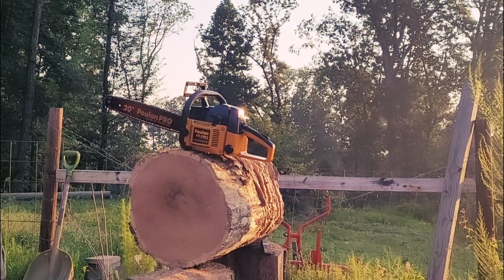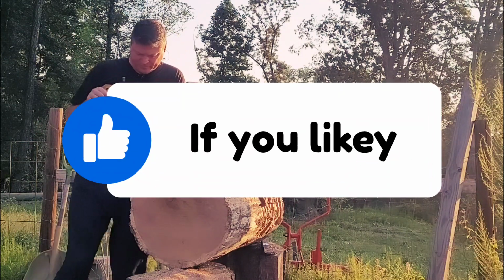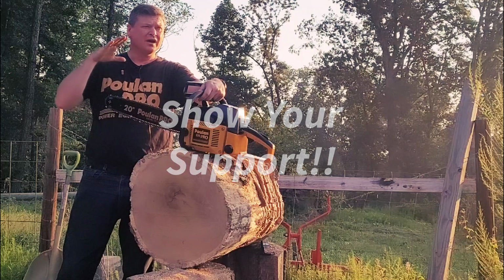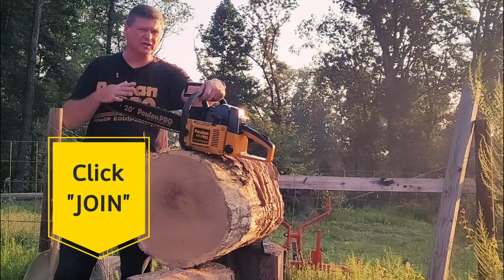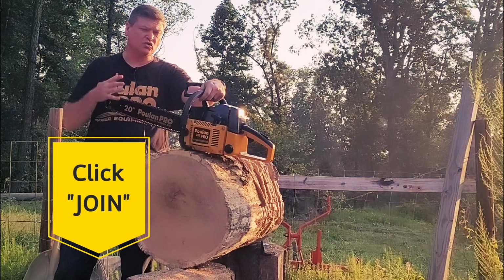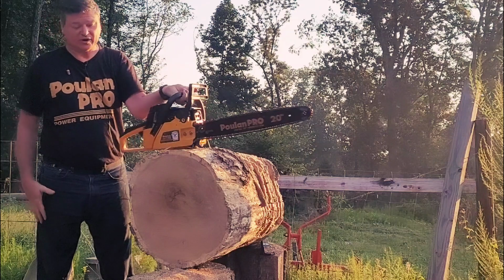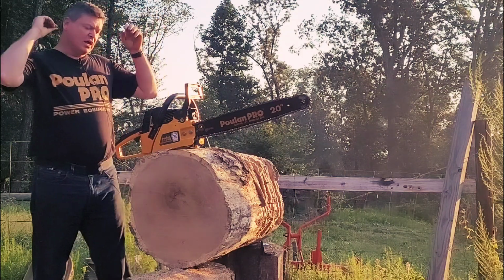All right. So here we go. Our numbers on this thing are 105.6, so most would probably call it a 106 on the exhaust. The intake is at 79. The transfers are at 122. So we got 16 degrees of blowdown, 43 degrees of crankcase compression.